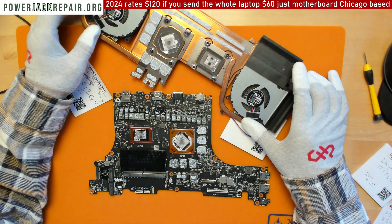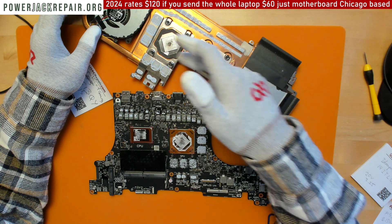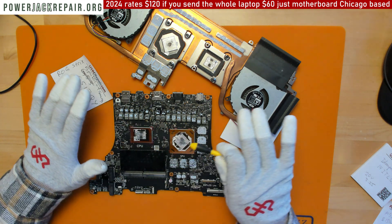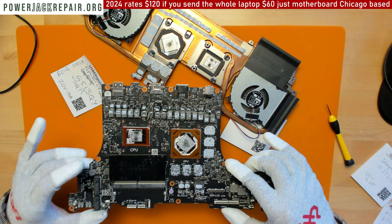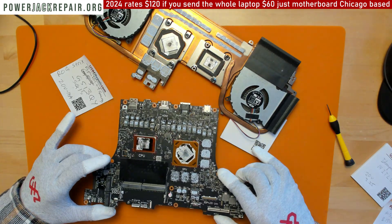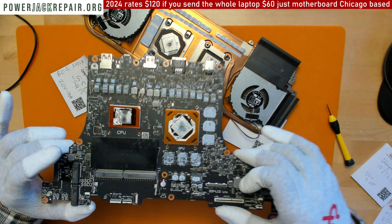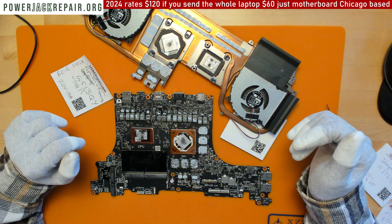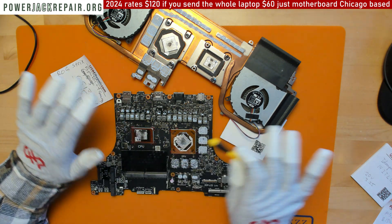Just before you're going to buy a gaming laptop, you need to be aware that there are burn marks here, right there, and right there — all because of the liquid metal paste. It just spreads around. You can see it flows — it flows even now from one side to another. Because it's a laptop and doesn't sit straight, you can see it flows from here to here. All I did was take this thing off, and it flows away from the hottest area to an area where it doesn't need to work as hard.